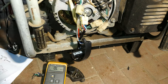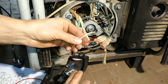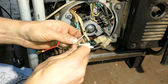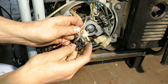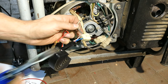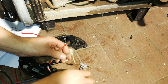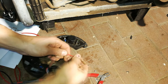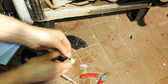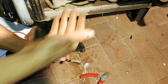I've cut these wires and joined them onto the new regulator. You can solder these — that's what I'm going to do. If you don't have a soldering iron, you could use a terminal block or crimp them with a crimper. I'm going to use a soldering iron. There — I've soldered it and put a bit of heat shrink on here just to protect it, because it does get a bit warm.